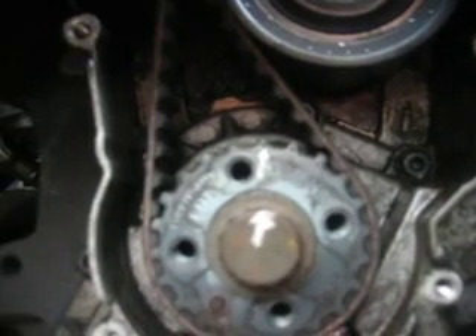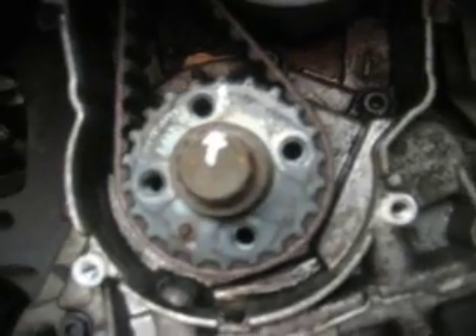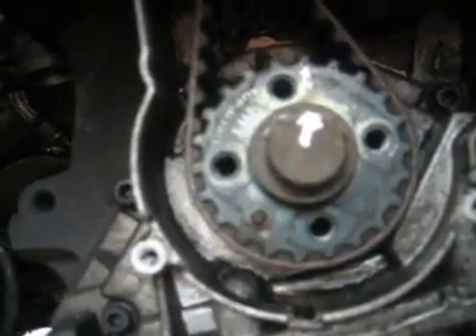Now, that is an estimate and approximate. You want to pull a plug on your transmission to see your flywheel to make sure you're at top dead center before you get going.